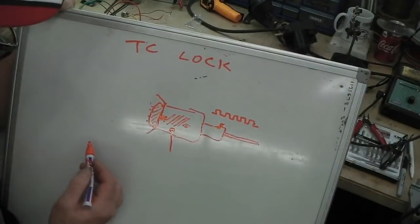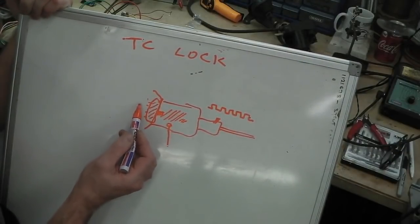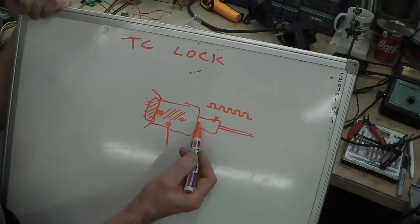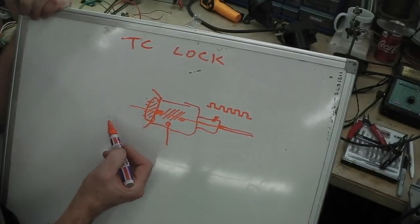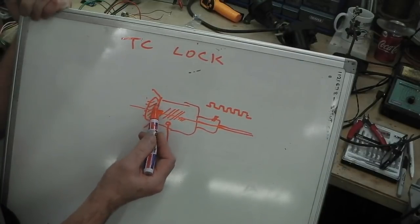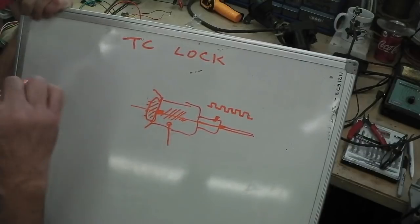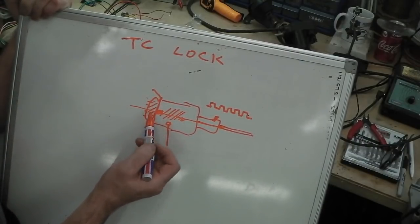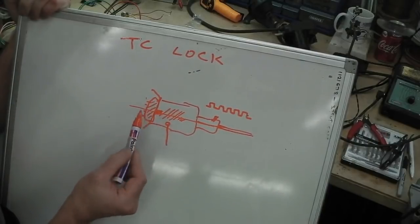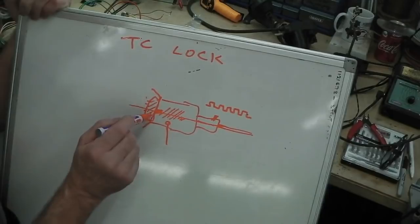What is it? Well, what they like to do is create a direct drive from the engine to the output shaft, almost direct drive right away through to your engine, so you actually eliminate the torque converter. The torque converter's filled with fluid, and the way that they work, there's two impellers inside, stators, some fluid inside the torque converter, all slushes about.